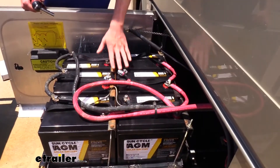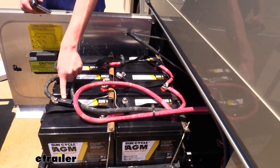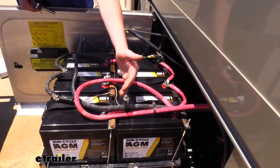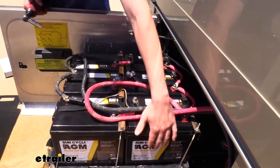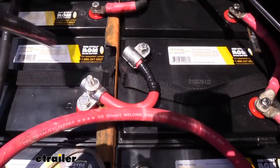After we finished the center ones, we just wired the outside ones back up how we had taken them off, hooking up our main lines last, making sure to also get that temperature sensor hooked back up. Then you can get it clamped down. When tightening these down, you don't want to over-tighten because you can damage the top of the battery — just until it's snug so the batteries aren't jiggling around. The bolts that come with your hardware are going to use a half inch.